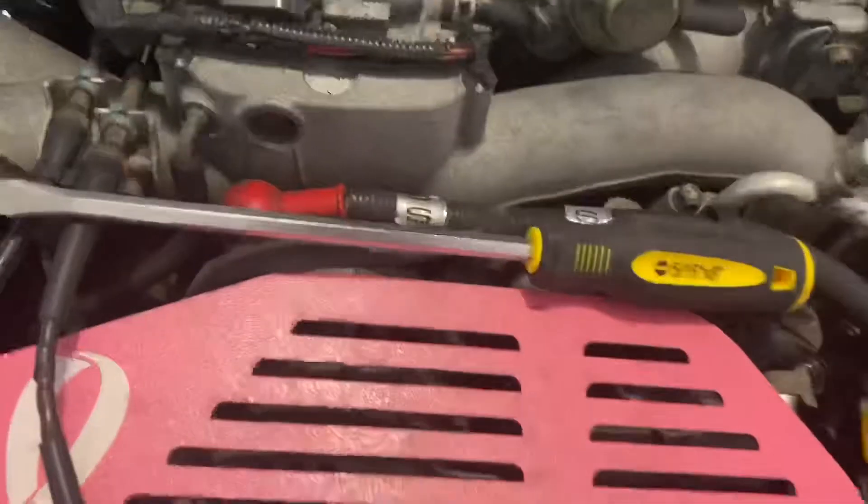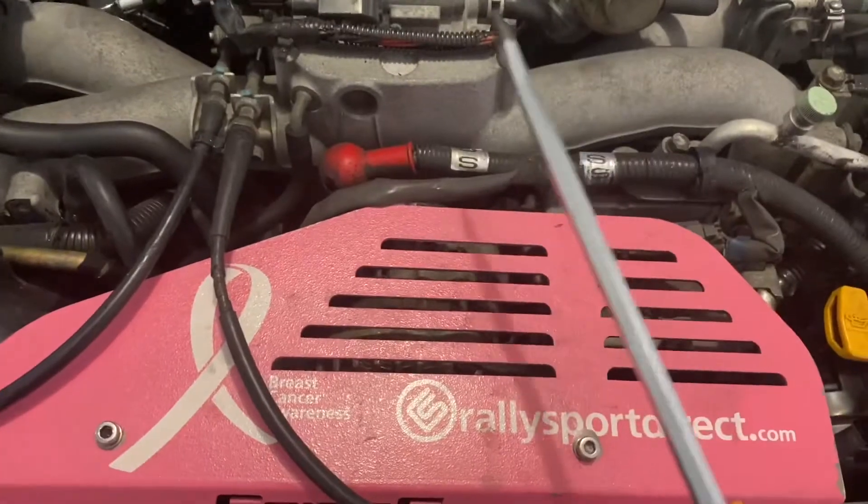So the thing I'm doing — it's a hit or miss, it's pretty hard — it's the idle air control valve. People on the forums talk about how the screws are soft, they break easily, blah blah blah. But I got it out already. I broke it off. I'll show you guys — this is the oversized flathead trick.